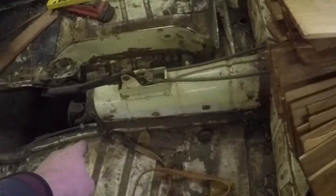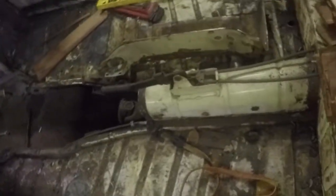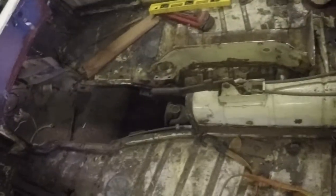I was just sizing it up to see how that can go in, and what's the best route to get it finished. And cut the seams down along the tranny tunnel. And once I've got the new front firewall sections put in, then the floor, I'll cut this floor out and that floor out. There's the old battery sill and the firewall. You can see why I took it out. It's just chewed. There's no way saving that, or no reason to save it if I can just patch in a new one, or a much better one.